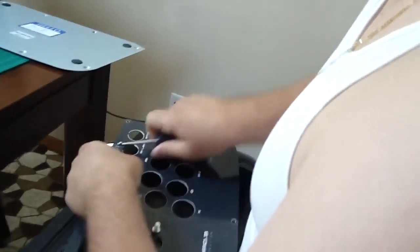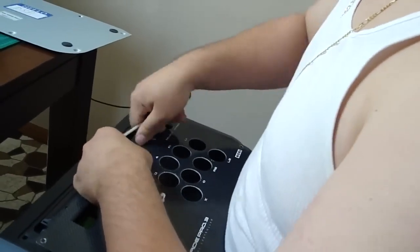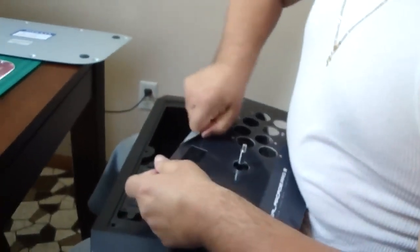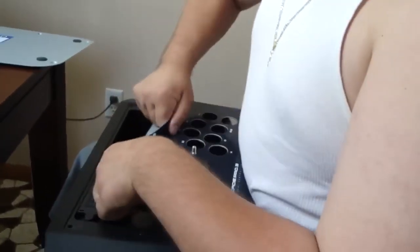As you can see, what Howard's done is he finally found a spot where he could get his screwdriver underneath this decal, and then you basically just have to tear it off. There's nothing else to it, but again be careful — you don't want to use too much brute strength because if you snap that metal plate you've lost the joystick unless you buy a replacement online.